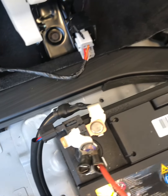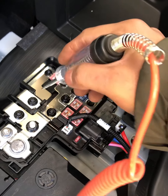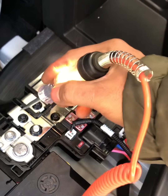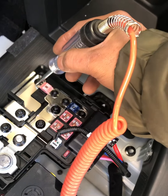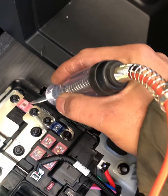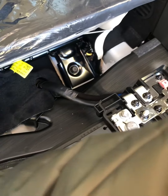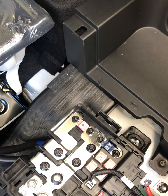So I'm going to go back to our battery. I hook up our negative there, check for power, that's good. So I'm just checking all like that. There's power there, there's power there. What do you find here? No power. Our culprit, the 125 fuse. So what I'm gonna do next is look for this fuse and see if everything starts.